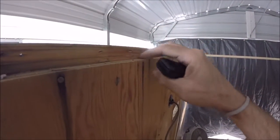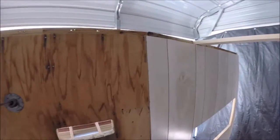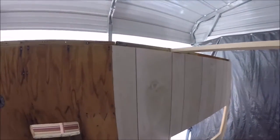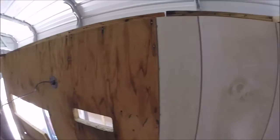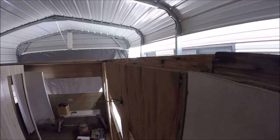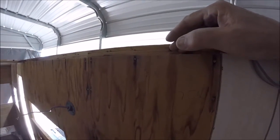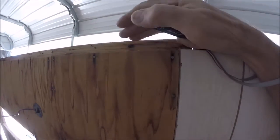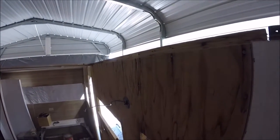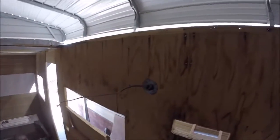I don't really like the design. This was done by Shasta for production purposes — a lot of it done with machines. The walls are assembled and then tilted up. It's to make for easy installation of the ceiling. I prefer the old method that the canned hams have, where it's just flat down and you put your paneling and framing all the way over, then build it up with curbing. This is something new to me because it's the newest trailer I've ever rebuilt.